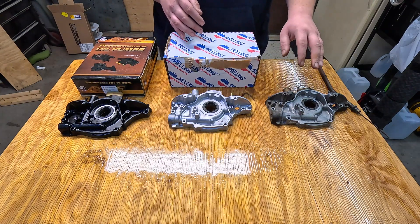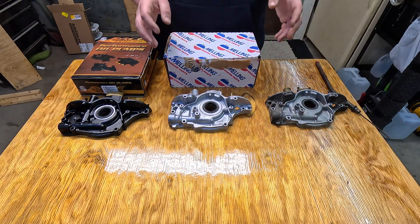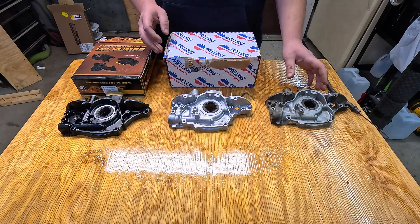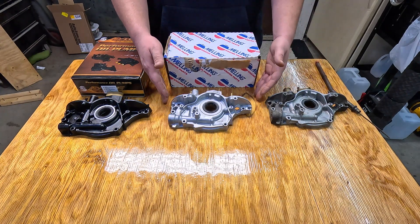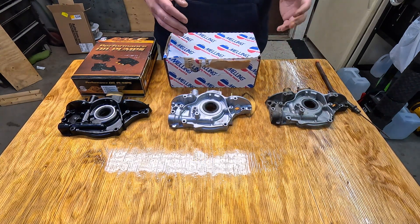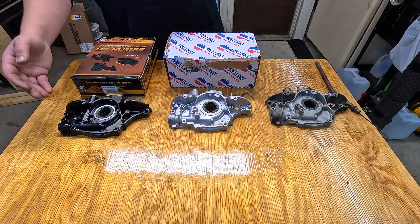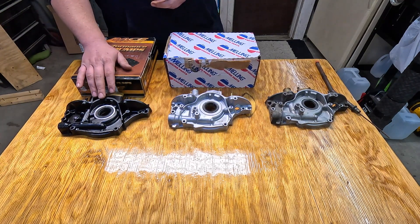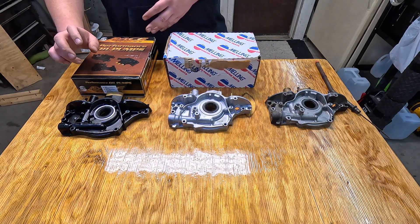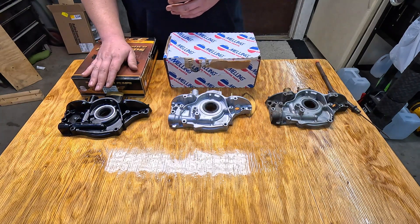This one would just be the factory Honda part number, which is what a lot of people do — they seem to be decent pumps from the factory. Now when you go to do an oil pump replacement for a Y8, you don't have a whole lot of options. You can either go with a factory genuine Honda replacement pump, you can go with the Melling option, or you can get a factory one and send it out to have it ported or hand port it yourself. Now as far as the Z6 is concerned, you can do all of those things, or you can go over to an ACL Race Series pump. So for our purposes, I'm going to say that this ACL pump — the aftermarket Race Series pump — is going to outflow these two pumps. So that leads you to the thought, why don't you just put a Z6 oil pump on your Y8 engine?